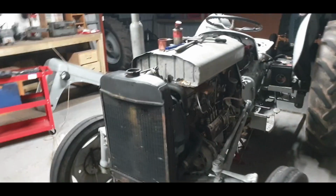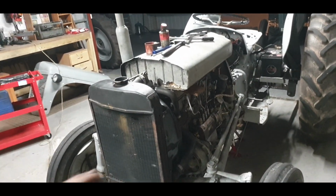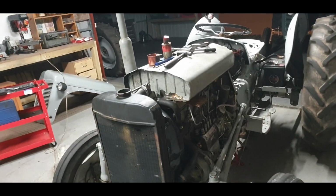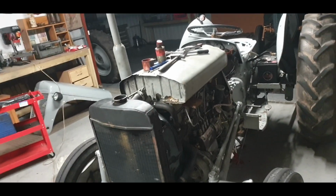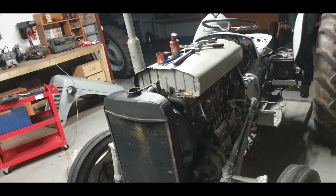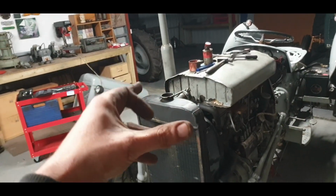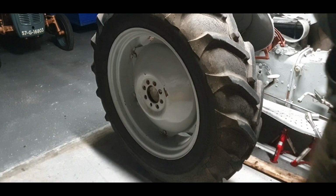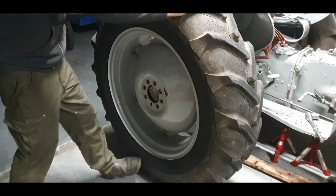And what I'll do then is I'll turn it around, so I'll be doing the other side for the brakes. I'll take off the tank, put it up on the bench there, see where it's leaking, clean it down, put a bit of JB weld there. I have new JB weld there, that should do it. And then when we have this wheel facing there, it's more light, we'll be able to start going on the brakes. May as well slap this wheel on. We have everything done. This side, it's only going to be adjustments, we don't need the wheel off for that.